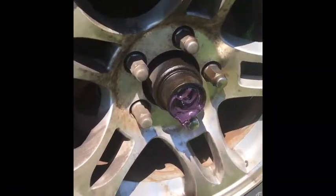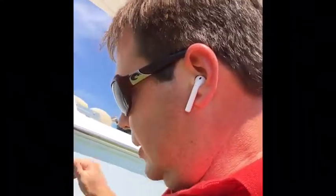Keep those hubs greased. You can actually see the grease pushing the water out, because that's all we're trying to do — keep good grease packed around these bearings. We don't want to be on the side of the road with a missing hub where the bearings have gotten so rusted up, burned up, and the hub has come apart and fallen off.